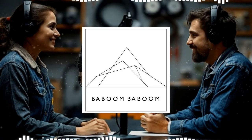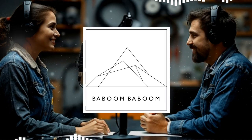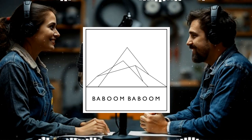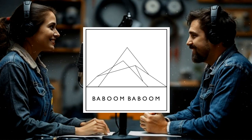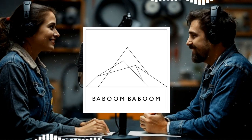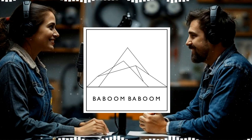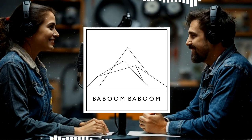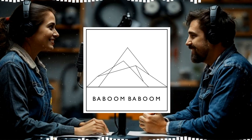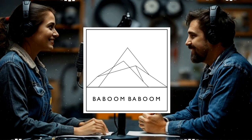Bare metal contact is key. Now, what about the location of the ground point—are there places we absolutely should not ground our trailers? One mistake is grounding to a moving part of the trailer, like a bumper or a fender, anything that's going to be shaking and rattling around. Over time, all that vibration can loosen the connection or even cause the wire to break. It's like trying to build a house on a shaky foundation. You want a solid, stationary part of the frame.